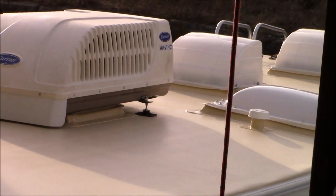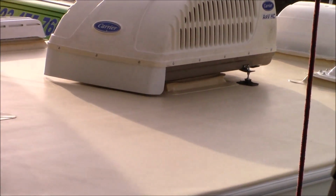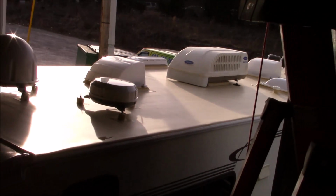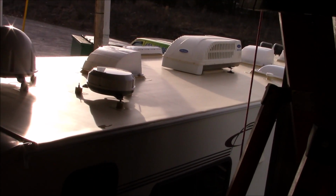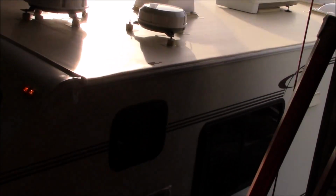I'm trying to get around there. I can show you. But it's a 60 mil GAF TPO. That's what it is. That's the product. So that's a 20-year roof system. But like I said, everything is all heat welded together. Then along the edge here, we go along this rail. That's all double layered. We put 2 layers on there.